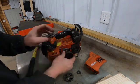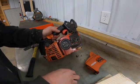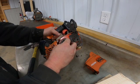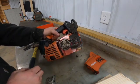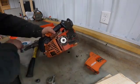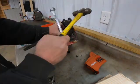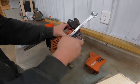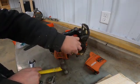Then the clutch hub. And then your spacer. Reinstall your clutch disc, remembering that turning it counterclockwise is going to tighten it back. And then we will use the same tool. Three-quarter inch going back. Couple of slot taps. And this will tighten on its own. That's why it's a left-handed thread. There we go.